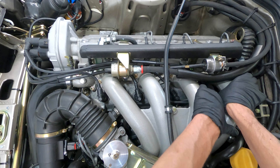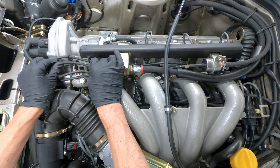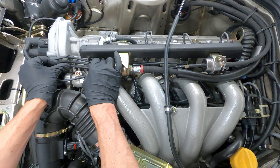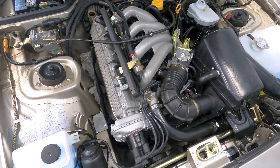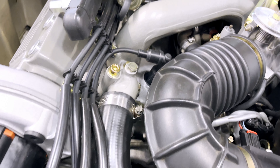In addition to visual inspections, there are a variety of ignition tester tools that can be used to test for no spark conditions. Most of these tools have a test lead that resembles the top of a spark plug and a clip that attaches to a metal grounding point. With one of the spark plug boots connected to the test lead and the grounding clip attached to a point in the engine, the tool can be adjusted to the desired test specification, and the engine can be started to assess the spark condition, repeating the test across all four ignition cables.